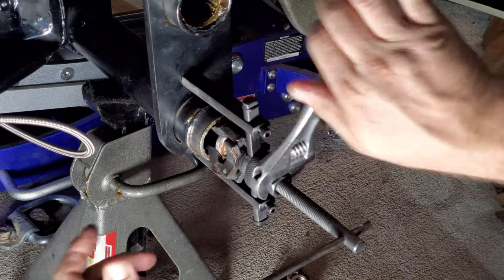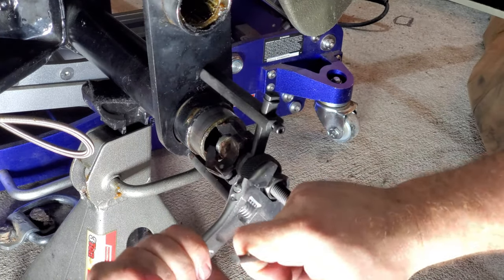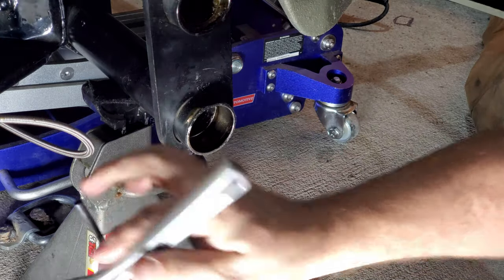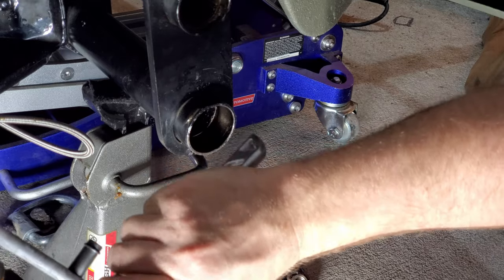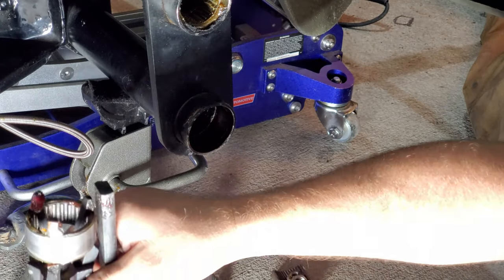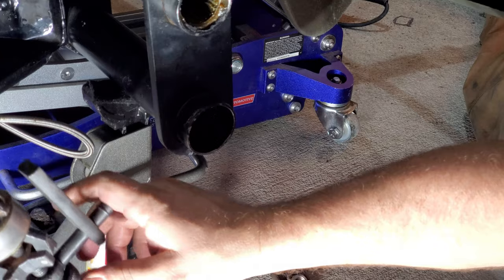Now, if you're looking to narrow your beam like a stock beam, this is going to be quite a bit different than what I'm doing right now, because you're going to have to add the adjusters and everything too. This beam is a 2-inch narrowed beam that you can pick up from, I believe, CIP1. I'm not positive, but I'll find it and link it in the description below. But what I'm able to do is just lop these off to get the extra bit of clearance that I need. And that, my friends, is pretty darn cool.